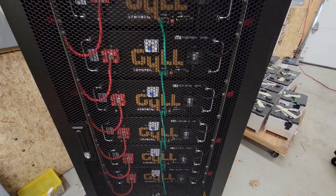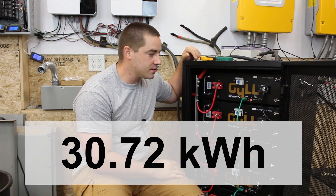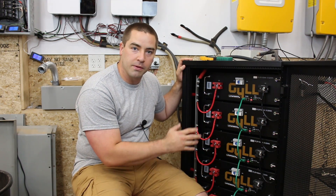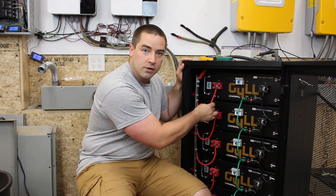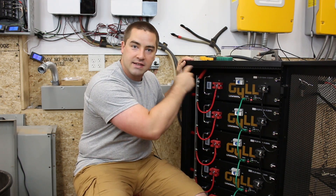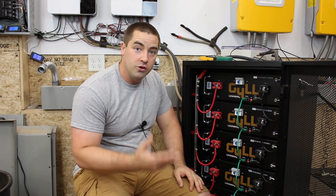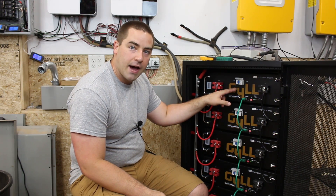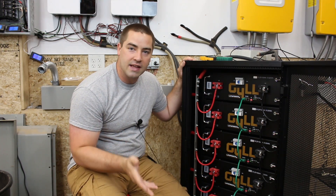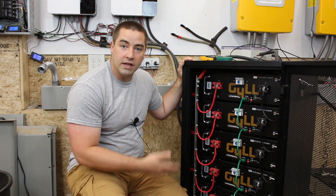Hi, I'm David. Welcome to my channel where I like to DIY renewable energy and energy efficiency projects. This rack of batteries has been working really well for me — it's over 30 kilowatt hours. I've received several comments where people have asked: isn't this setup wrong? You're supposed to have equal length wires for the positive and negative running to one central point, so the electricity flowing in and out through the inverters has an equal length path to each battery. In theory, that would be equal resistance and every battery would then be equally used. But since the top battery has a shorter distance to the inverters and the bottom battery has a longer distance to travel up through the bus bars, doesn't that mean the top battery is going to wear out faster? Well, let's find out in this video.